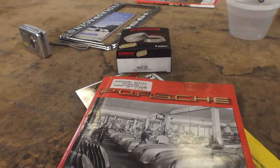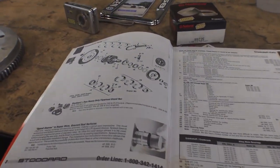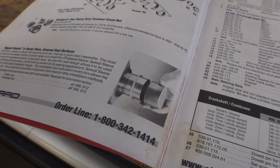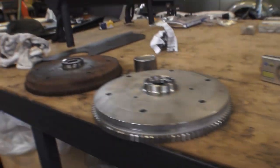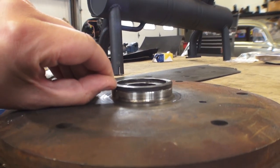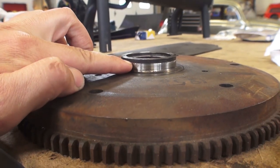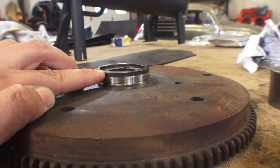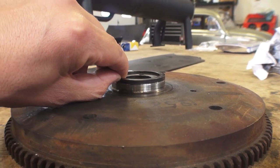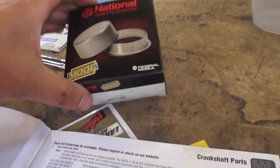A lot of you Porsche guys out there would know this book — early 356 Porsche stuff. I was just thumbing through, seeing how the parts are similar to the Beetle, and I came across on page two of the book something called a speedy sleeve. What this does is it's like a little hat, a little sleeve that goes over the neck of the flywheel. As I was saying, as time goes on and the motor runs, the rear main seal will cut a groove into this neck of the flywheel. So no matter how many times you put a brand new seal in the block, the fact that there's still a groove on the neck of the flywheel, it's not going to matter — the oil will still seep past and you will get a drip. So if you have a groove that's dug in enough where you can catch your fingernail, that usually means you're going to need to machine the flywheel, or if you have an older bug, get a new flywheel. Or here's the alternative — something called a speedy sleeve.